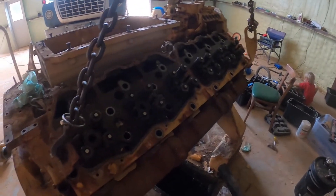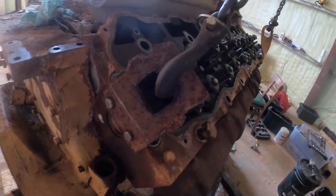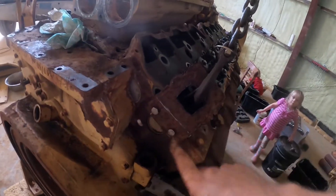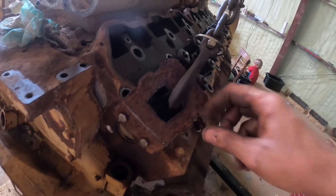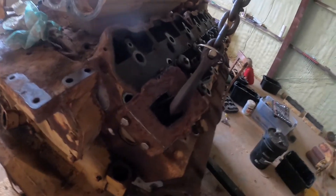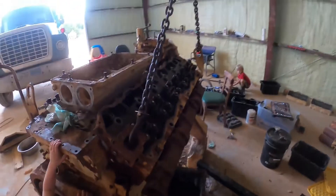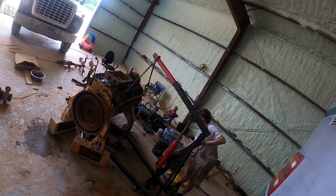All right, here we go. So I conjured a rudimentary lifting apparatus so I can lift up on this side of the head. There really was nothing here to hold on to, so these are existing bolt holes — they were not used — so I had to clean them out a little bit, and then I just made this piece of metal, drilled the holes, and put a big hole in it for the hook. So we'll give her a tug. Now we have to step back because I'm gonna try to lift the head off. Step back, don't get close to it, look where it's going. There you go. It came up.